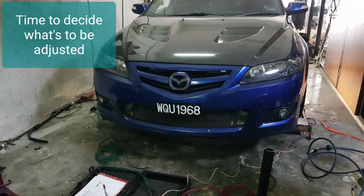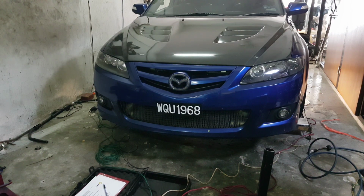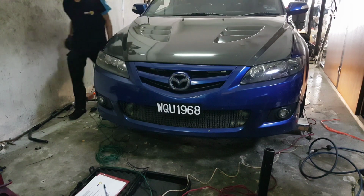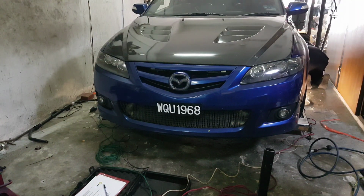Okay guys, this is Elton again. After calculation has been done, and after putting me in the car, Aidan now knows how heavy I actually am. He has come to a conclusion that he needs to increase the preload on the front left of the vehicle to achieve his 50-50 weight distribution. So let's let Haziq jack the car up and get the preload adjustments done. In our next video we are going to be looking at the data again, and let's see if it's achievable or not.